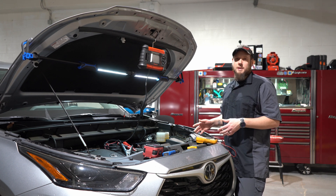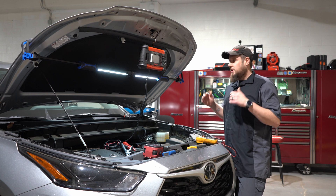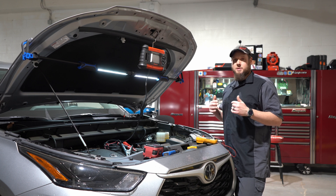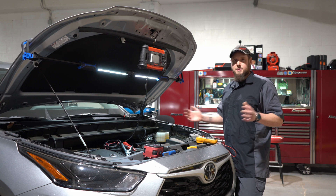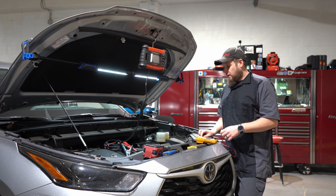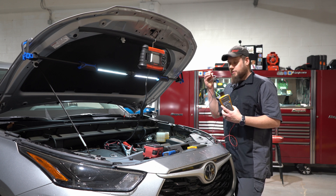The third thing is don't disconnect that battery. The second you disconnect it, all those ECUs lose power, so that ECU that was acting up and was glitched is no longer glitched. So even after an hour everything's gonna be perfect until about two more weeks when it's back on the tow truck. So don't disconnect the battery to run this inline.